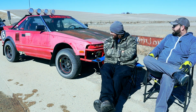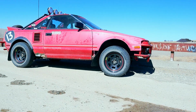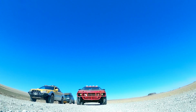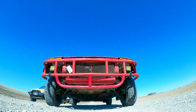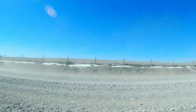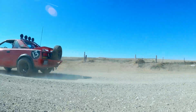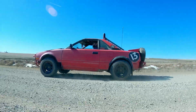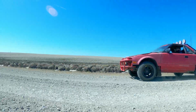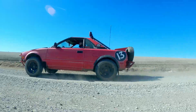It's lifted on mid-90s Toyota Corolla front wagon springs and struts. Used those in all four corners, and then I had to have a welding shop make some 2.5-inch spacers for the rear because it sagged horribly. With the rear, I used the MR2 top mounts, but the struts bolted right in, didn't have to drill them, and it still needs lifted more in the rear because the springs must not be very good at all.